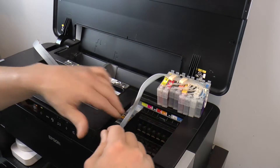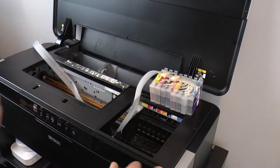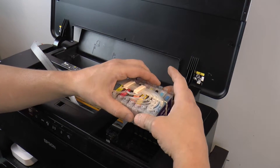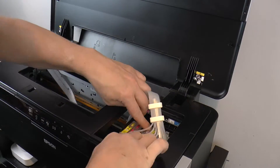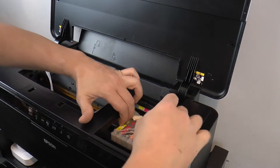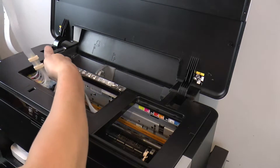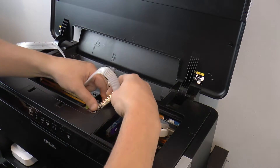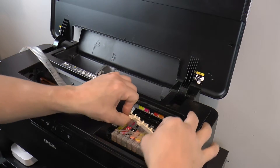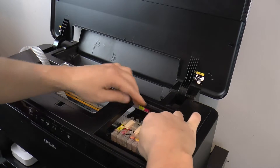Now that the carriage is back where I can plug these in, power off the printer by unplugging it — don't hit the power button or it's going to go crazy because there's no ink in it. With the power disconnected, the carriage stays in position so I can feed the cartridges in. Just make sure when you snap these in that they actually click in and are snug. Before plugging the power back in, I'm going to manually move the carriage all the way left and then all the way right to confirm there's enough slack. There's also a bar here that snaps into holes on the top — if that gets tangled up, put it back where it belongs.